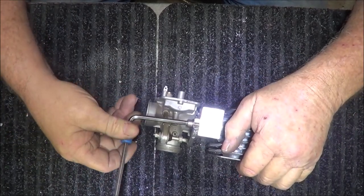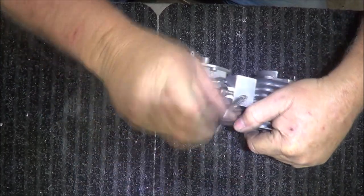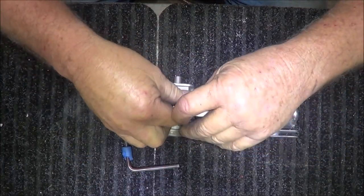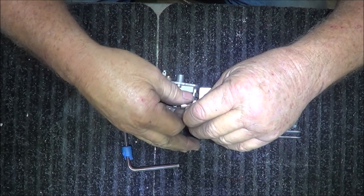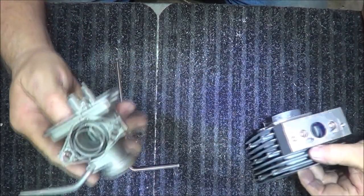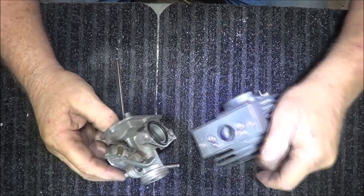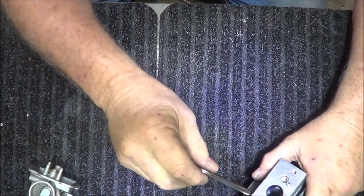And I know the comments are going to be, why in the hell did you waste your time and my time watching your damn video over a damn carburetor? We don't know that. Because flopping around on a hose, to me, isn't the way it goes. I had to do it on a twisted T-bike, but I bought a reinforced turbo hose, so it didn't bounce around a whole bunch. So it's got an O-ring in it, so it's going to seal good. And I cut two dowel pins, so that registers it to where it's got to go every time. And then this will bolt naturally to the jug.